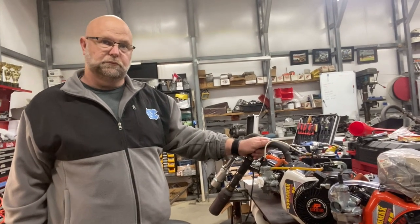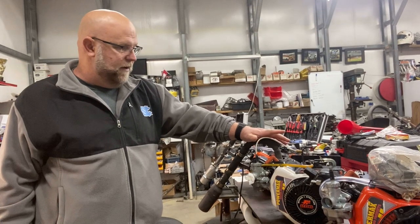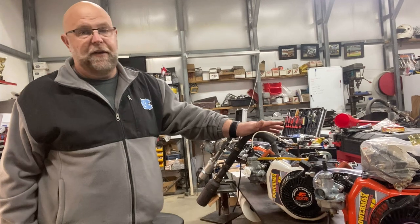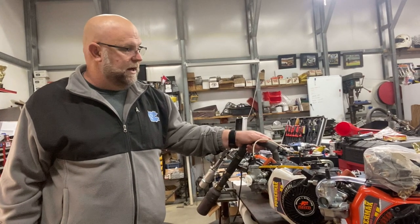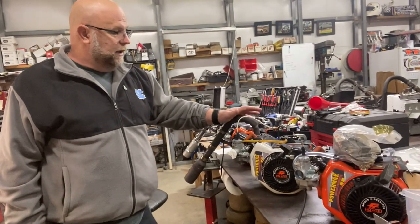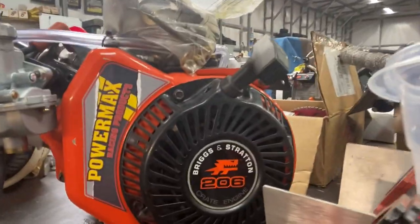How often should somebody get their motor refreshed? When a customer comes in to buy a new engine from us, we suggest we break it in — it's an extensive break-in period, and we have a special way that we break them in. After that, we suggest you go about 500 to 750 laps, then bring it back in. We'll break it down. First thing we do is make sure that everything has stayed compliant as far as the rules are concerned. There isn't a whole lot of moving around, but we do have some stuff that changes from time to time — the rocker arms are bad to be a little bit rogue on some changes. But it's 500 to 750 laps.